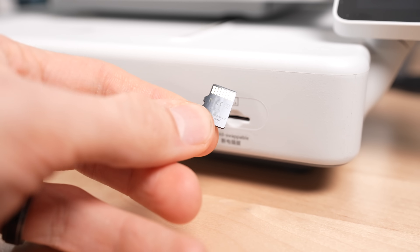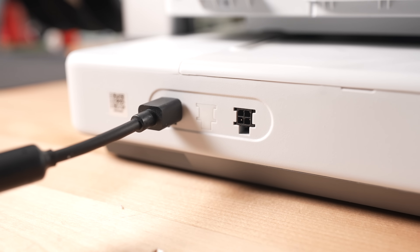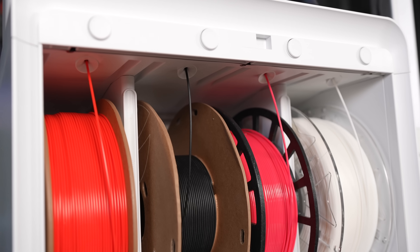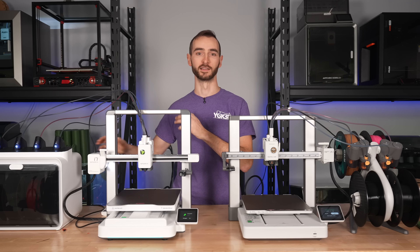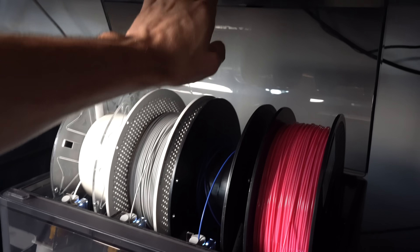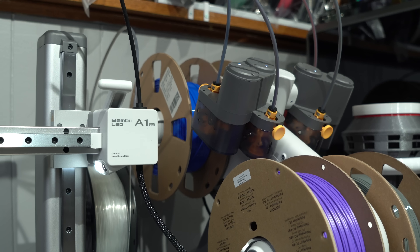As for ports and peripherals, the A1 has a microSD card slot whereas the i7 has a full-size USB, but the i7 only has one accessory port compared to two on the A1, and that's already occupied by the CFS light. Speaking of the CFS light — don't let the name fool you, it's actually an upgrade over the original CFS. They've turned the design on its head so the filament feeds towards the top instead of the bottom, which seems to solve the biggest problem facing these units: incompatibility with cardboard spools. Because the feed motor is pulling up and gravity is pulling the spools down, they don't lift off the rollers or get jammed like they did in the original CFS or Bamboo's AMS. Compared to the AMS lite, it's fully enclosed with a spot for desiccant to help keep filament dry — a major advantage over the open-air design.